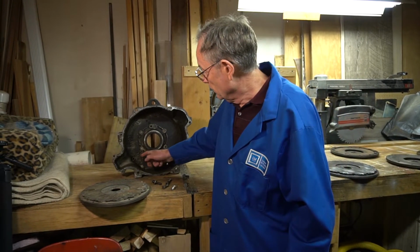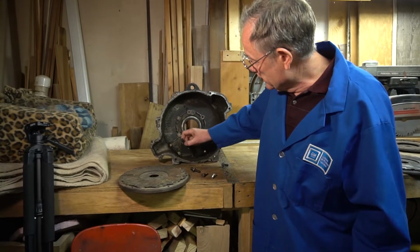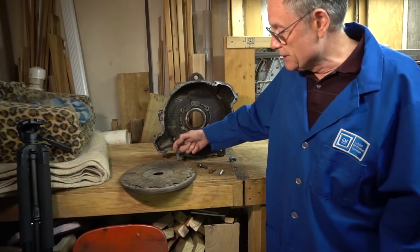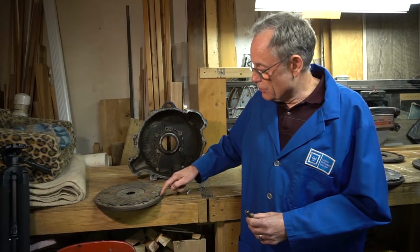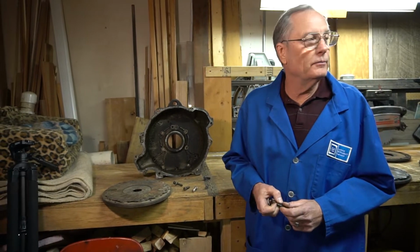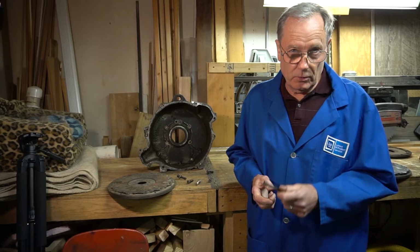It's very important. I've had cars come in where the flywheel had been hitting the bell housing bolts, and in one case it hit enough that it spun the bolt out, and as soon as it came out it jammed up in the flywheel and the engine wouldn't turn anymore. I'd almost bet that's what happened there, because that one is damaged deeper than any I've ever seen. So badly damaged, right. And the engine just locked up. It was a customer's car. He'd come in for something else. He went to start it and the engine was stuck. How did that happen? Well, the answer was a bell housing bolt backed out.